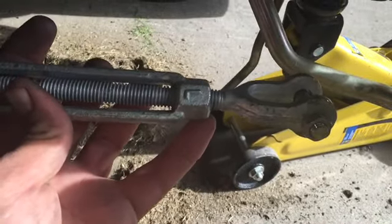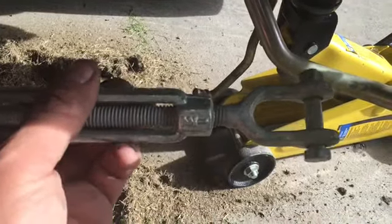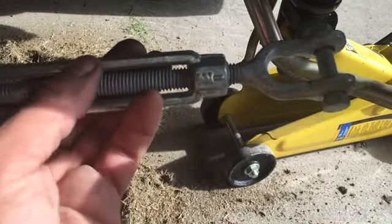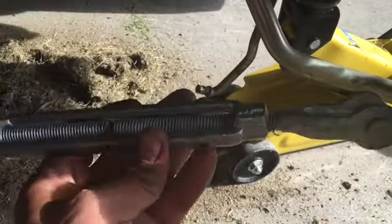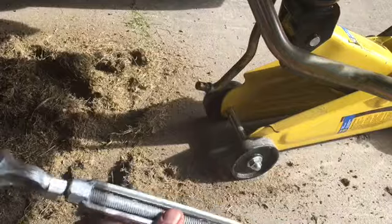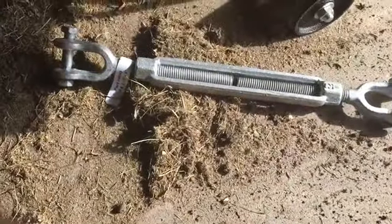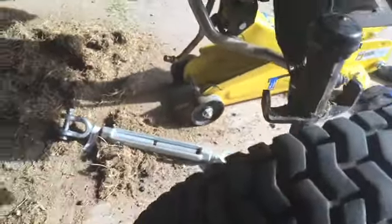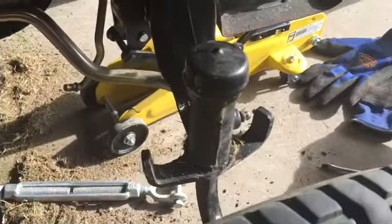You can have just one end if you like, but you have to make a full 180-degree flip of the tie rod. And if you only need 90 degrees of flip, that means you're 90 degrees past where you need to actually be again. So you don't really get any further ahead without having dual adjustment. So that's option 2. I'll section out a piece of that steering rod, and I will weld that turnbuckle in, and then you'll have adjustment, and you can infinitely adjust the toe in and toe out. And that will be the end of this problem ever again.